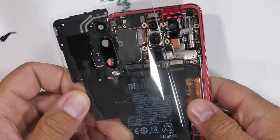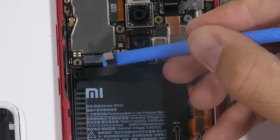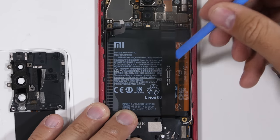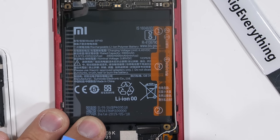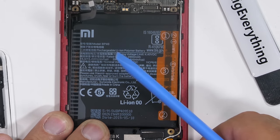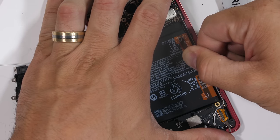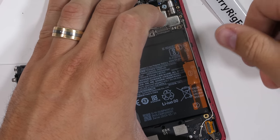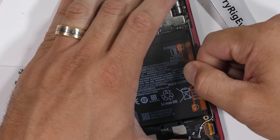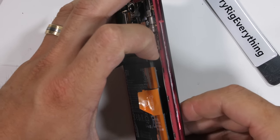Let's go deeper. I'll unplug the battery connector like a little Lego. Then I can unplug each end of this long extension ribbon, and then we can remove the battery. This is one of my favorite styles of battery adhesive — the strong, tangible pull tabs. The adhesive is thinner than the magical pull tabs we see inside iPhone, or even the permanent adhesive we see inside the Samsung phone.